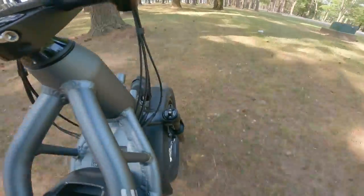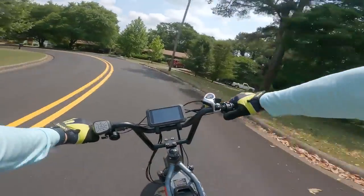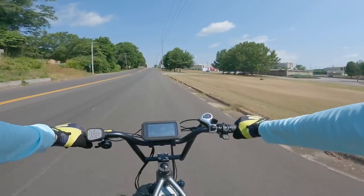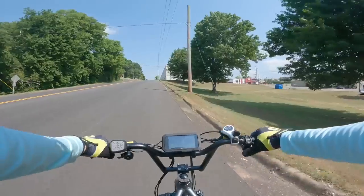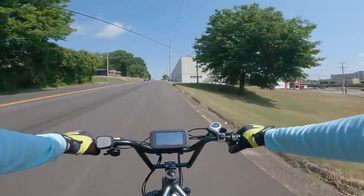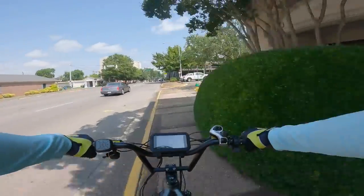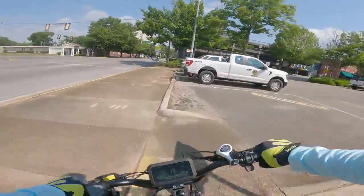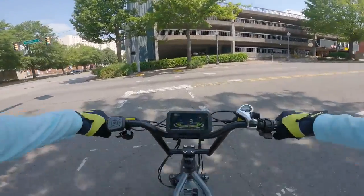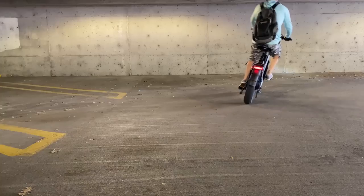It's smooth enough for some off-the-path riding if you need to cut through a yard or two between streets. Performance: can this bike reach 28 miles per hour? Yes, easily, and it can hold it. The five pedal assist modes will range in speeds from 8 miles per hour up to 28. On the bike I have, throttle only, I can hit 28 there too. Performance on hills: Fucare rates this bike as capable of climbing up to 30-degree inclines. On one of the steeper long hills in town, I think I hit a record — 19 miles per hour up the hill in pedal assist. When I stopped and went with throttle only, I was still able to get 12 miles per hour. For usual street riding, this is a wide and heavy bike, yet somehow very nimble — at least around city sidewalks. It handles less like the e-moped it's supposed to be and more like a mix of a regular bike and a dirt bike: stable at low speeds but also easy to dart around with plenty of extra power. High speeds, no problem. Low speeds, no problem. Agile — another word that comes to mind — and a Vespa term: flickable, which is a good thing.